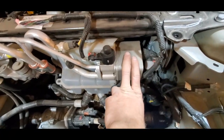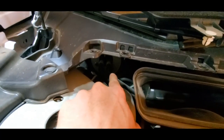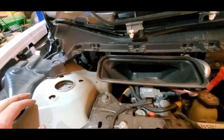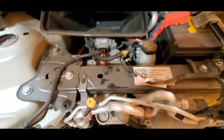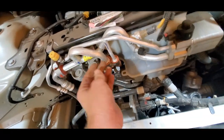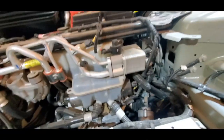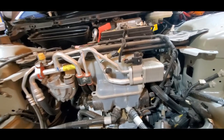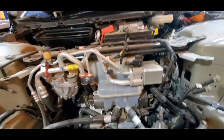Another interesting tidbit is this heat exchanger right here. This is your coolant reservoir — coolant runs into a heater core in the cabin, just like on a regular gas car. I would have assumed it would just be a heating element, but it actually uses a heater core. You've got your AC compressor on a motor right here, and I can feel this is cold. It's running not only into your cab but also over to this heat exchanger. I think if you were ever on a really hot day, like 100 degrees, and it wanted to cool the battery down to say 75, it would be able to do that using this heat exchanger instead of just cooling with the radiator when ambient temps are higher than your target temp.